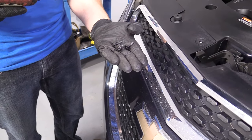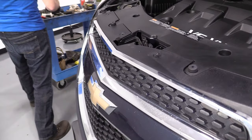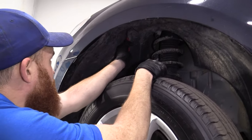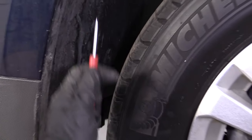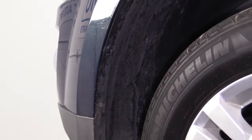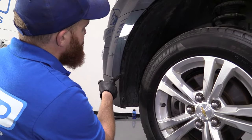Those all look the same. This can move around a little bit. So we're going to do some push clips here — there's a push clip right there, another one right in front of this tire, and here and here. After we remove those, there's a T20 and a T20 there. Same tool that we used up top, we're going to use down bottom.